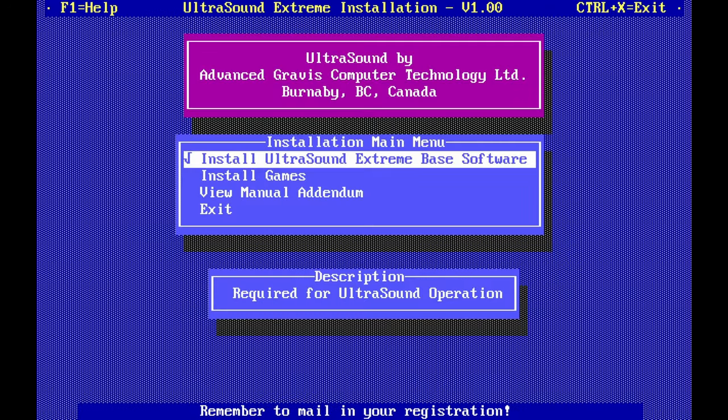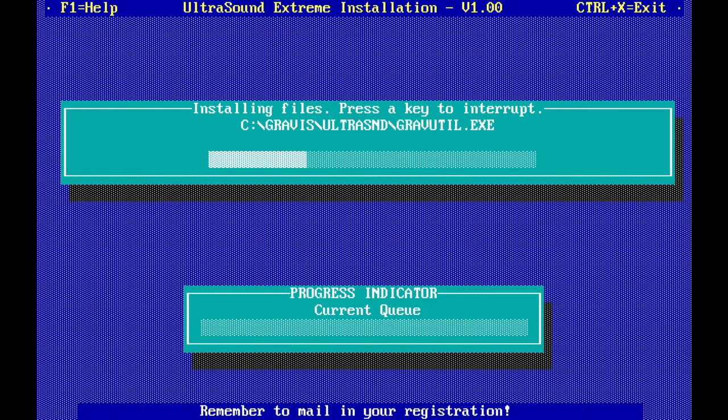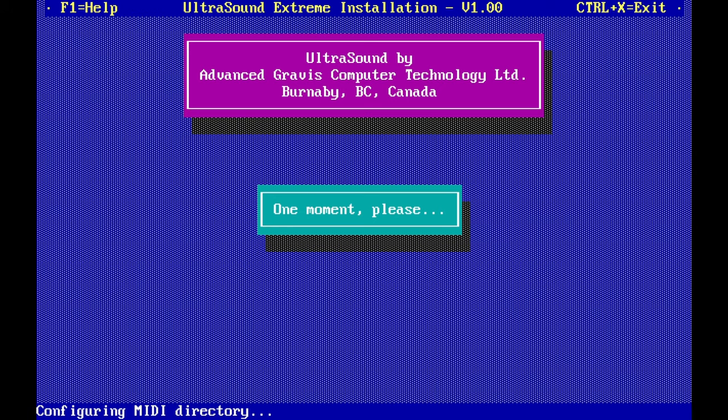by drivers. The driver installation in DOS is as easy as with other Gravis sound cards. Just run the installation program, follow the instructions and that's it. Set proper IRQ and DMA for GF1, then for ESS, test all settings and carry on to the next step. Setup will update system files and reboot the rig. I didn't experience any problems, almost all resources were free on my BX and FX setups.